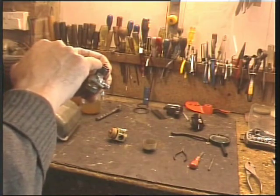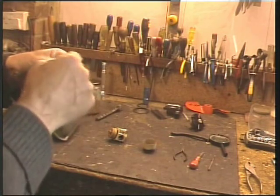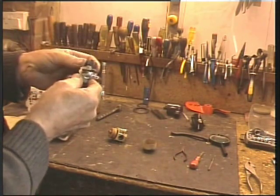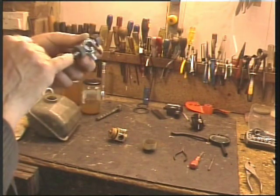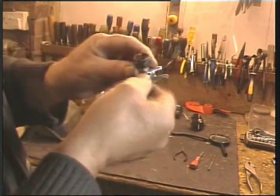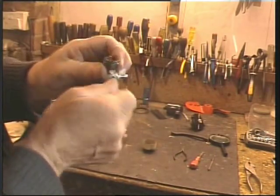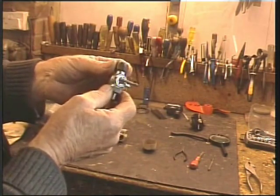Unfortunately the gauze top I couldn't do anything with. I've actually cut it away, which is a shame, but I'll put on a Seagull gauze. It's a shorter, lower one, but it doesn't matter, that'll do the job. And I found I could take this apart by making up a little tool that unscrewed this, and you can move this about, and this little casting had two channels, and I poked those out and blew through those, and that works fine now. So we've pretty much conquered the fuel problems, I think.